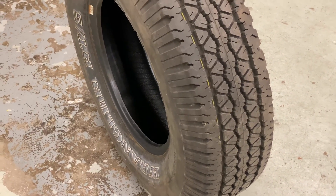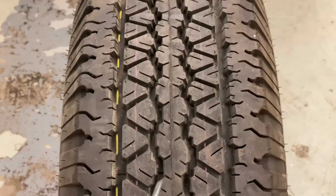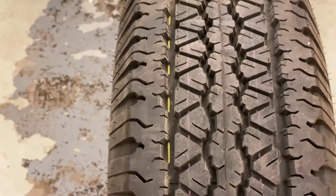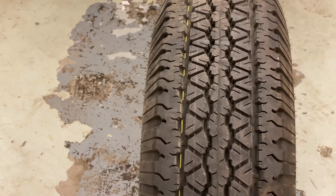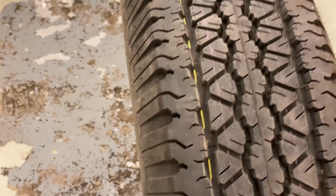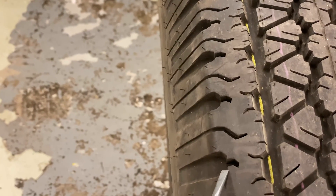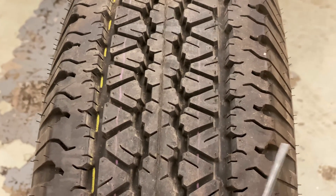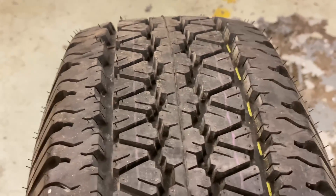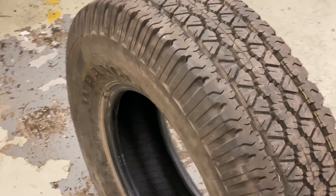The first type of tire we have here is called a symmetrical tire. Symmetrical meaning that it is the same on both sides no matter how you look at it. Now if we imagine we cut this tire right down the middle, it would literally have the same pattern on both sides. You'll see this exact same notch on the other side — granted they're going the opposite way, but if I flip this tire, that notch is now facing downwards just how the other was facing upwards. So that's our symmetrical tire.